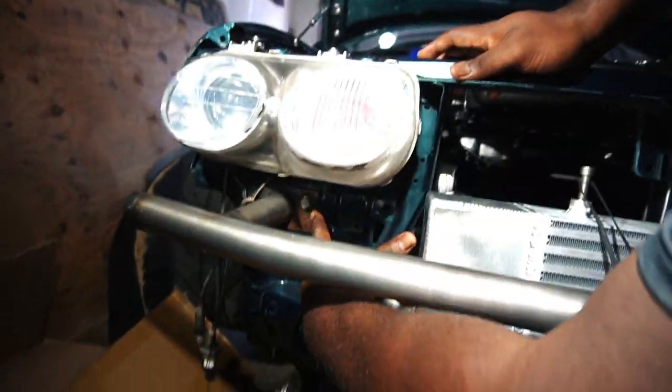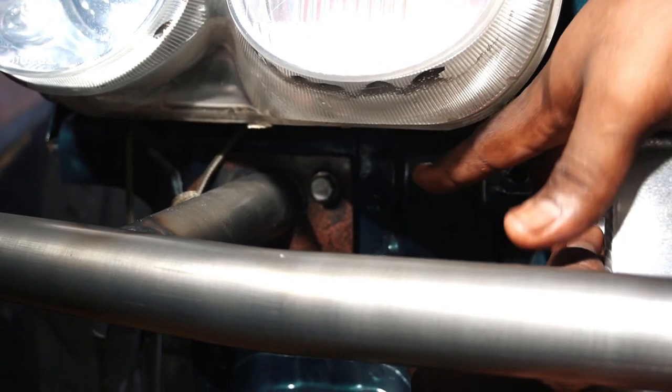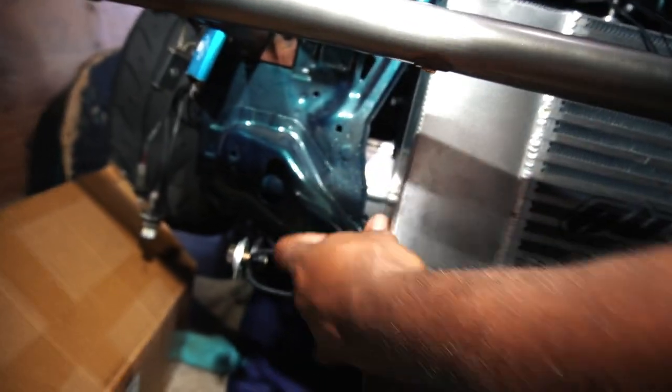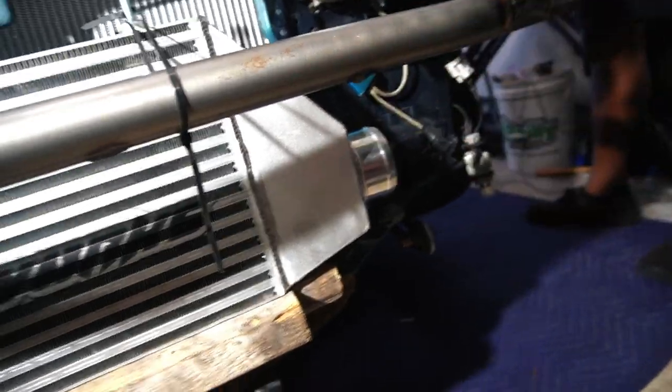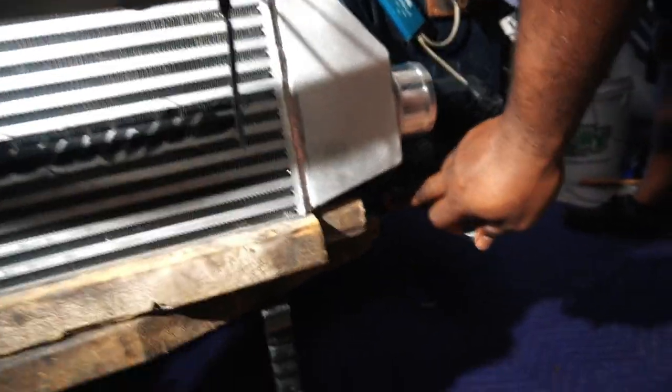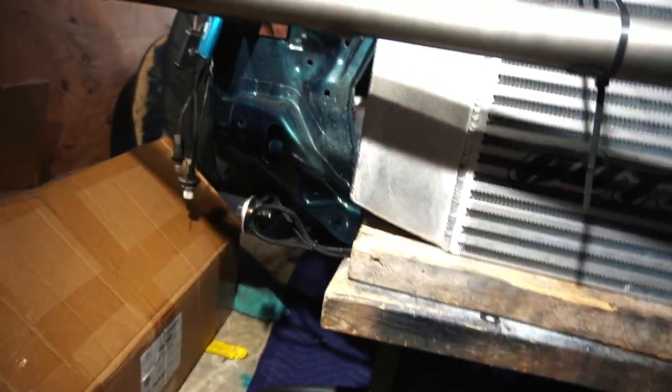I'm going to make some mounts. We're going to have this little bone — I'm going to weld one here, and then have a bracket that comes off of here. So we tie it from here to here. And if I put another one down here, tie it from this bolt hole to here. So you have two anchor points right there, and then two more over here. From here to probably here and have a bracket, and then one more probably down here. That would be the best way to go about it, because you're still utilizing the factory bolt holes. I have one right there — I think that's a 12 mil. That's a 12, and then we're going to run that. And this is also a 12 too.